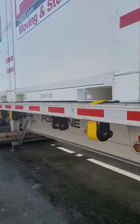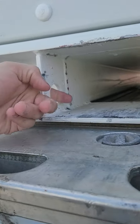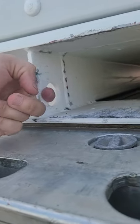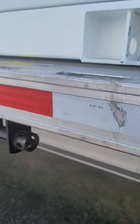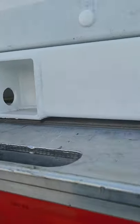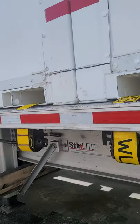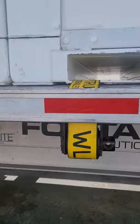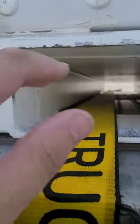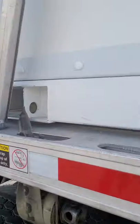You can use these holes for securing the load with a strap or with a chain. If you have a chain, you put the chain hook right here, drop it, bring it up, bring the chain back, hook it to the other side, put the binder on the chain and tie it down. Or you can do what I did here and use straps, which is very good and solid — I've never had a problem with this way of securing the load.